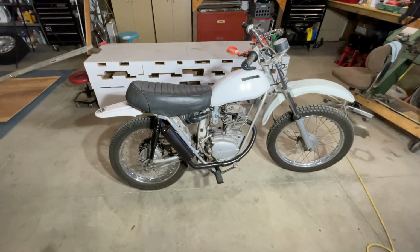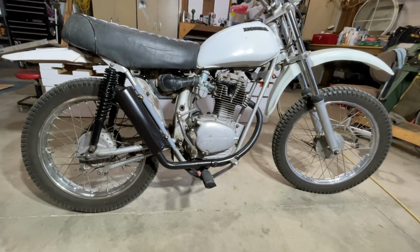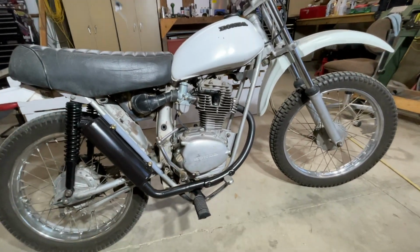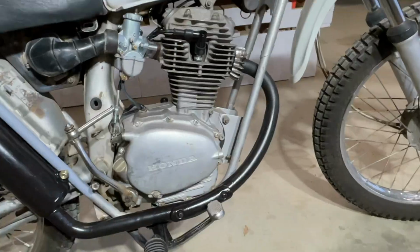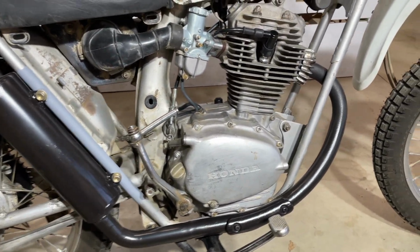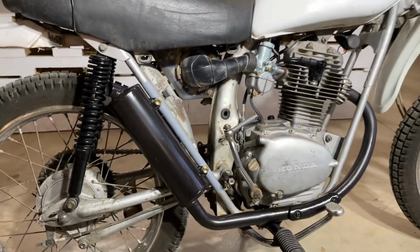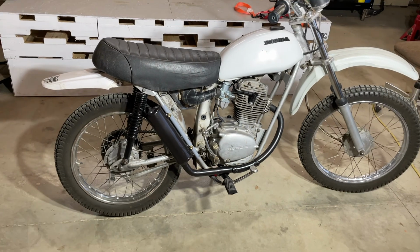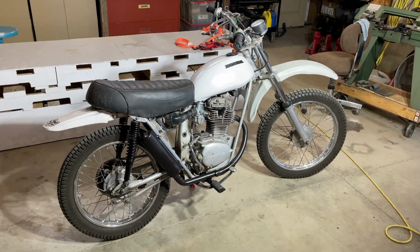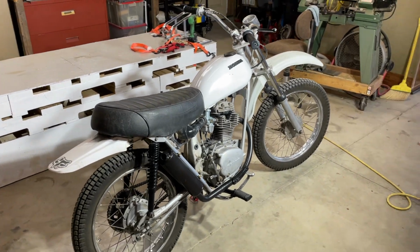Barbecue, paint burning. Color's not bad. See, the color went flat up at the front of the header there, and then glossed the rest of the way. Probably just got a little warm. It didn't want to idle up the street, but I don't know, could be just a choke thing. Seems like it ran better this time than it ever has, so we'll have to keep test riding.